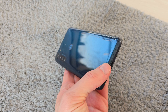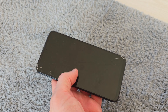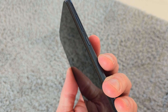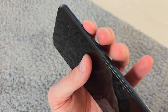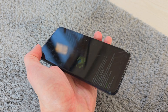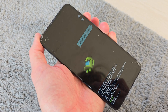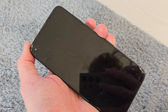First of all, we have to charge up our phone, then you have to turn it off. It should be turned off right now. Now press and hold Volume Down and Power button together — press and hold both keys, keep holding, then release the key. Now navigate using Volume Down to the option named Recovery Mode, then accept by pressing Power.